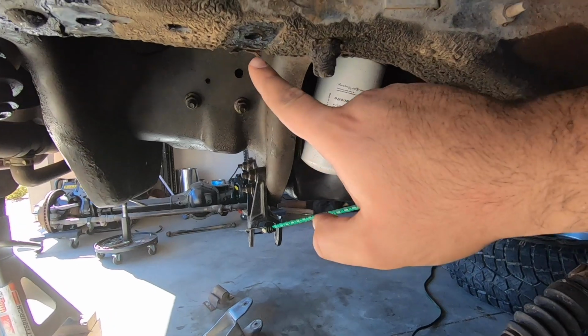So we went ahead and beat it with the chisel and the hammer until the head of that rivet kind of twisted up a little bit, and we were able to get the grinder in a little bit better, and we cut it off a little more, then we beat it completely off. On the back side, so like on this one right here, like you saw, we used the bandsaw and we got up behind it and completely cut it off.